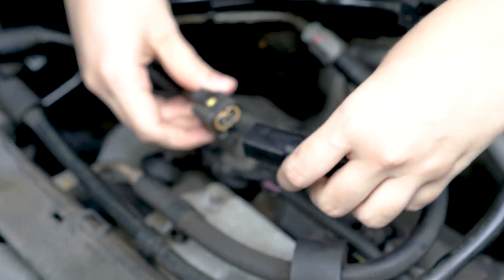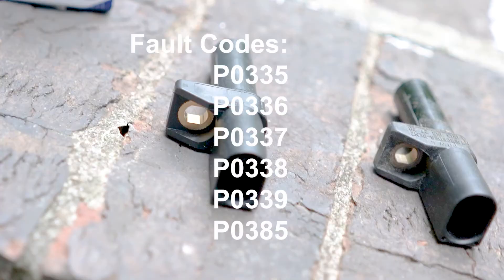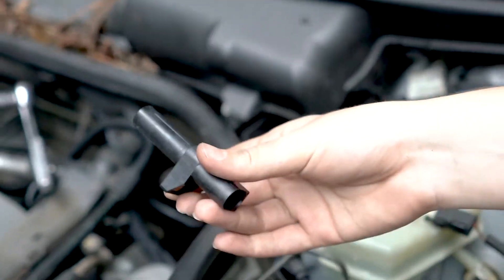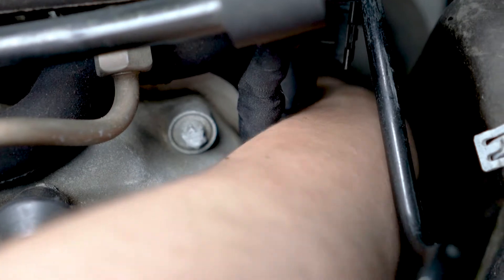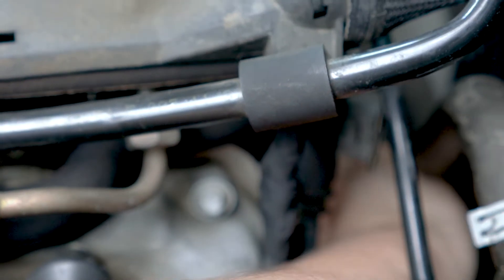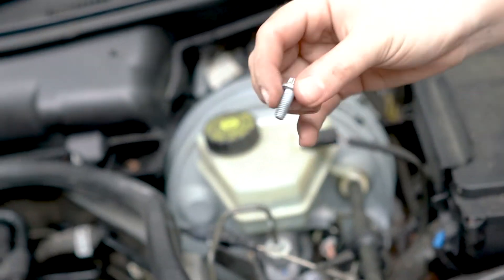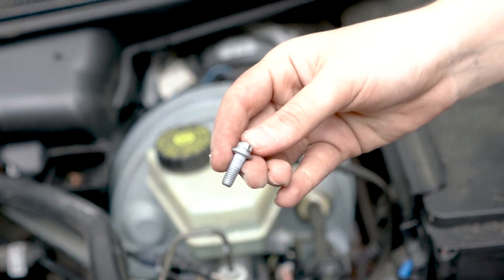It does throw a code too — you might see your check engine light. If you can get the code, you'll find out whether or not it is the crankshaft position sensor. It's only a $26 item, often neglected as a maintenance item. It's best that you do this every 70,000 miles on the E and S classes of those years — early 2000s, late 90s.